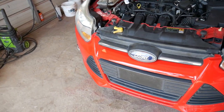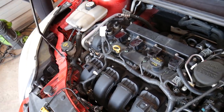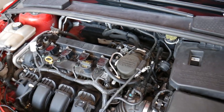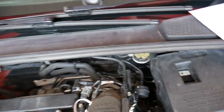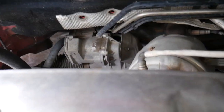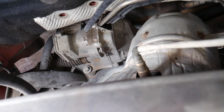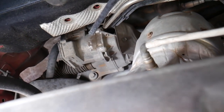This is the engine — a 2.0 Ford Focus — but even if you have a 1.6 or 1.0 turbo 3-cylinder engine, the procedure will be about the same. Code P0171 usually indicates a bad oxygen sensor, specifically the one right before the catalytic converter. The upstream oxygen sensor is the sensor that tells the car how much fuel and air to spray, so if that sensor is bad you may get code P0171.